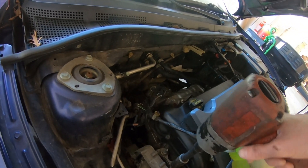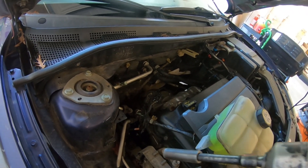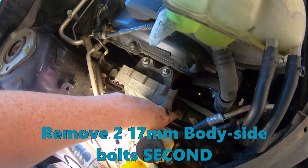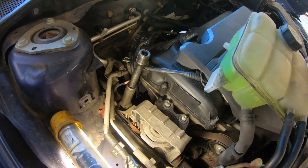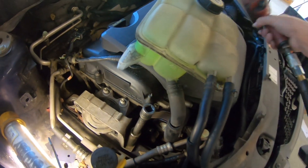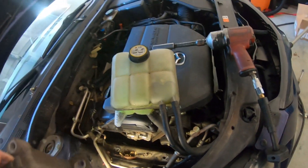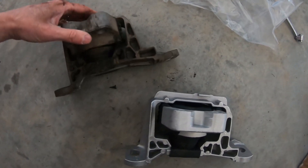I'm going to use an impact wrench to do it and make this job simple. If you don't have one you can do it by hand. You can see the engine shift as the second nut comes off. Now we're just going to use our impact wrench to remove this 17 millimeter bolt and this 17 millimeter bolt on the inside of the fender. And now our mount is free to come out of the car. With the mount out of the car you can see just how badly broken it is — it's in two pieces. This has probably been broken for a really long time.